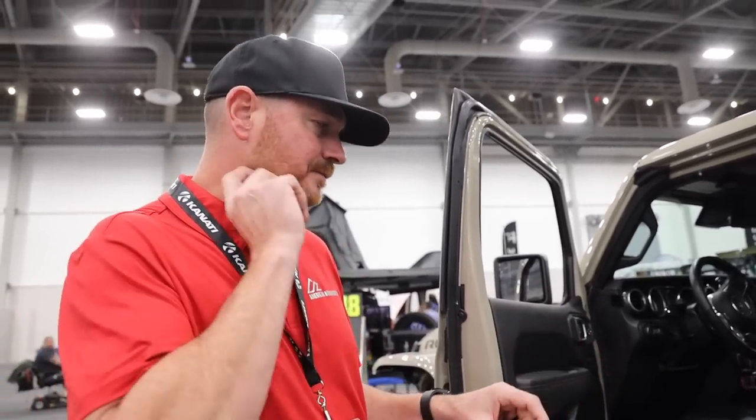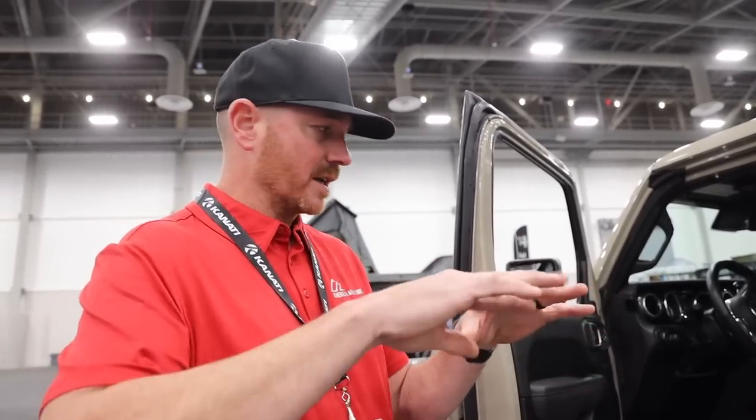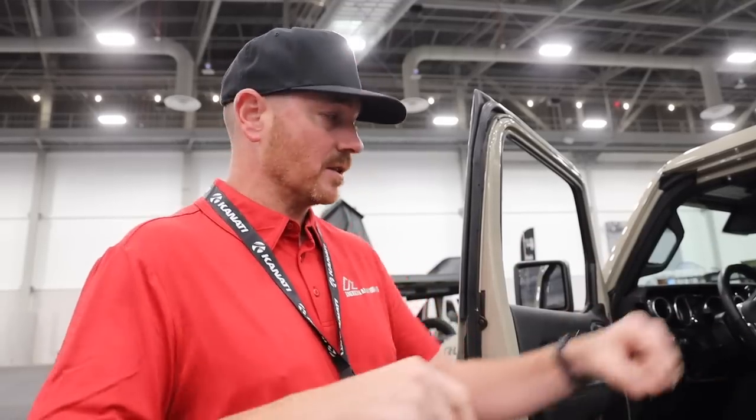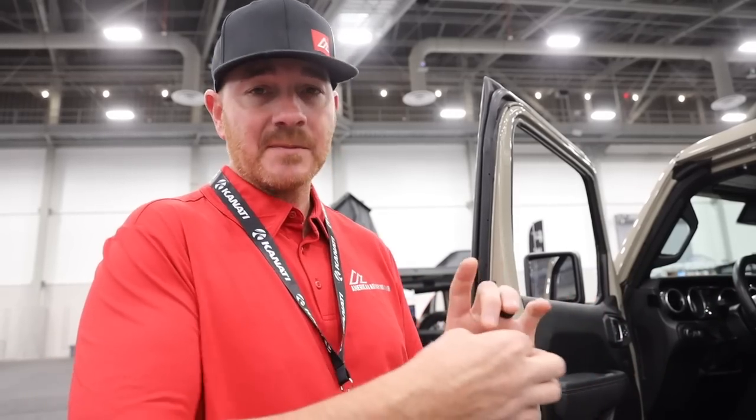Do you have to remove the whole seat to get to it? Absolutely not. So that was the other cool thing that we really tried to do. Most of the other mounts in the market go under the seat bolts. I didn't really like that. I didn't like changing the seat angle from factory and stuff like that. So all of this bracket mounts on top of the seat. So you do pull out the two rear seat bolts. We replace those with longer ones, and we give you a spacer pack that goes between so you can really crank down on those bolts. But yeah, like the install process, not counting the wiring, is probably about 5 minutes with that thing under the seat. And it's been great so far.